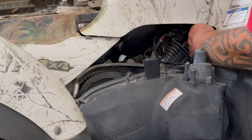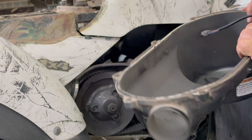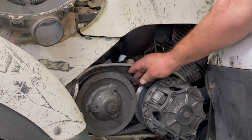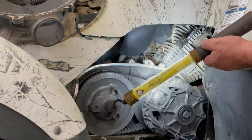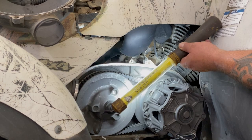We just got to unhook these wires — you just pull the pin and pop them out. And there's our cover. And that's where our clutch belt is. As you can see, it's getting really worn down. Still good, but it needs replacing. We've got a lot of debris in there, a lot of belt dust and everything.